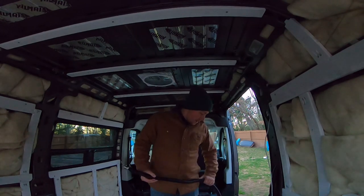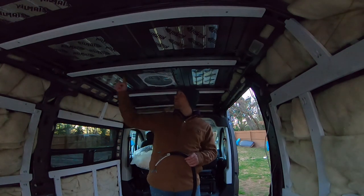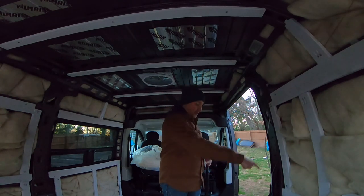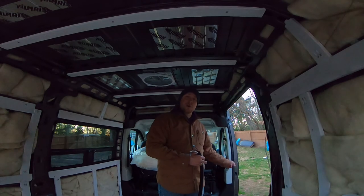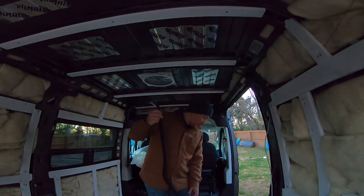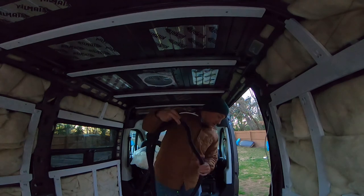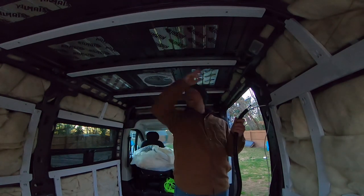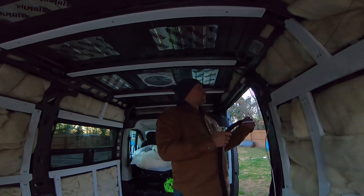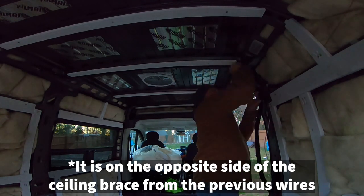The sun is going down and I'm here trying to run the last wire across to the opposite side of the van - a wire for both the living room and bed lights. It went up and across this pillar, down the side pillar, and will come to the switch at the door, then connect to a three-way switch so we have two separate switches. I ran loom and taped it to all the connectors at the switch, then we need to fish across to the other side, keeping it close in this pillar and running it up and over.